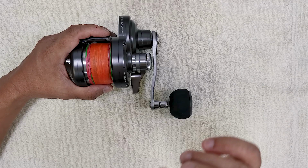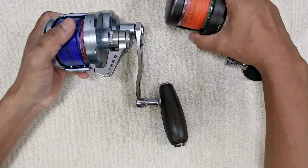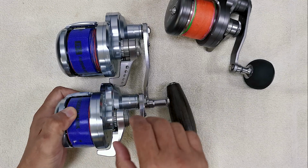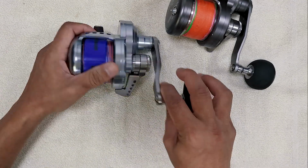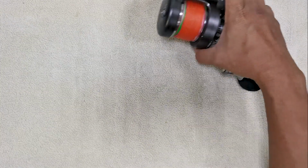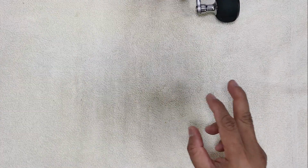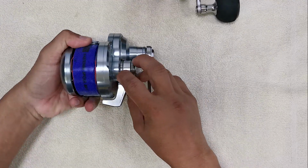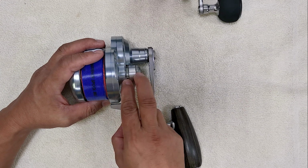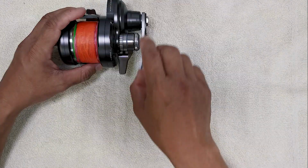Now, moving in, the very next obvious thing is this one. Now, if you look at the L100, you can see that this part right here is actually quite big. Okay, comparing that to the L80. Now, this is the cam chamber, and inside is the pinion gear. The pinion gear on this has two ball bearings, as opposed to the L80, which has one. Sorry about that. Okay, so there's only one bearing that supports the pinion gear for this. For this, it has two.